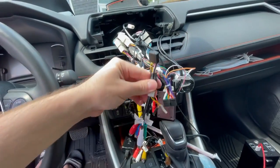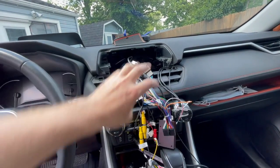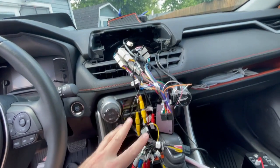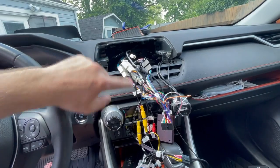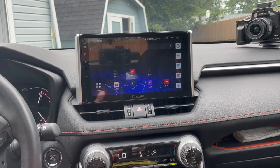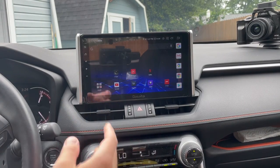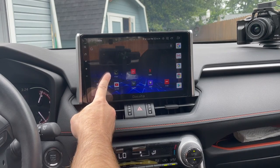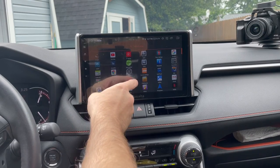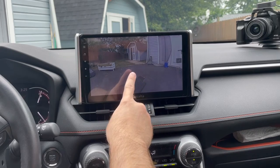This is just overall another wire harness that we need to shove behind this rat's nest. We connect this to the back of our head unit and then we should have access to the front camera by using the front camera app. The head unit accesses the front-facing camera through several options. The first is through a built-in app called F-Cam that I have a shortcut to on my front display. It's also built into one of the apps in the unit, so if I press F-Cam, you will see the front-facing camera.